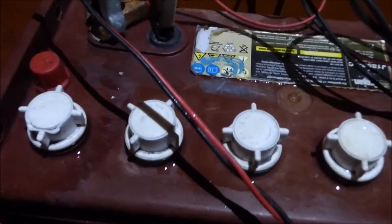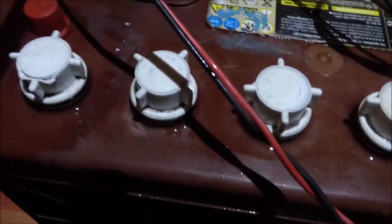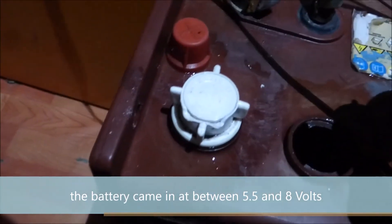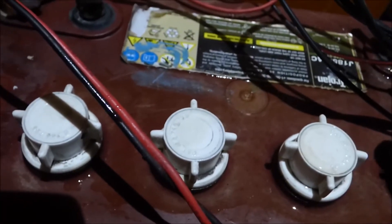Now for observations — if you recall, you see the batteries: it's a combination of me pouring water and the gassing. Cell number two and this other cell were the bad cells — this one actually visually looked really poor. Yesterday, believe it or not, this one actually started to bubble. I don't know if you could see in there, but it's actually bubbling — yes, you can see it. So this one has started the recovery process. However, this other one refuses to do anything; it's just flat. We're hoping that in time it will also start to respond.